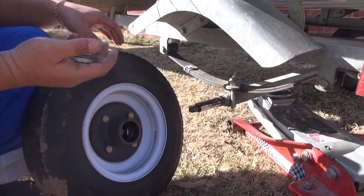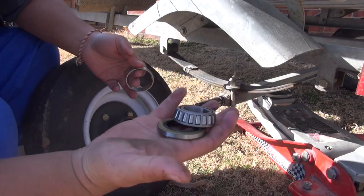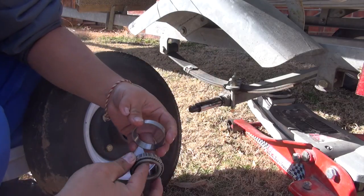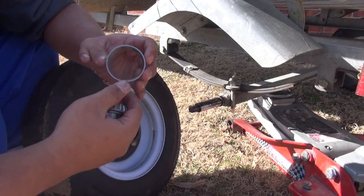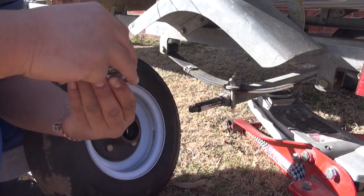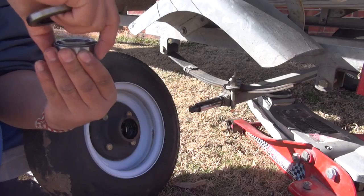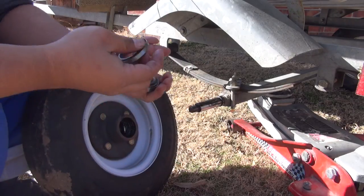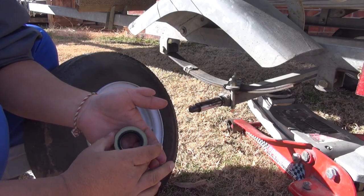The new kit actually comes with a new bearing, a new bearing, and a new seal. So far you've only seen me take one piece out — there's still this other piece you got to take out. This piece has got a conical shape to it so the bearing can sit inside like that. You've got to pack this bearing — I'll show you how to pack it in a little bit. Essentially it goes back in like that and the seal sits on top just like that.